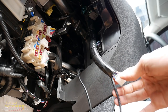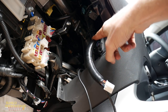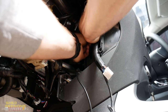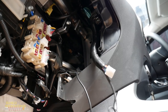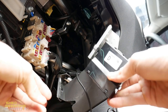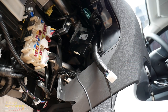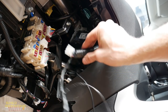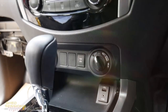Once you're happy with your wiring, all covered in conduit or tape, put the main harness clip back in — push all that harness back up and clip it back into place. Then take the diff lock control box and put it back up into the same spot, put the Phillips head screw back in to secure it, then take the original plug and clip it back into place.